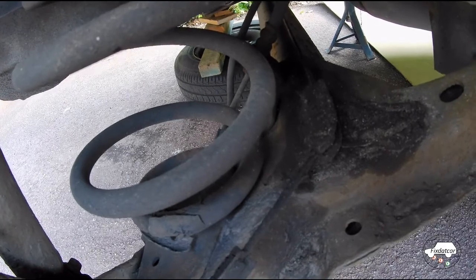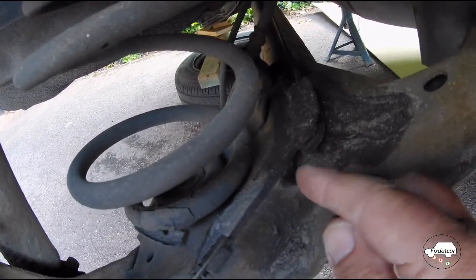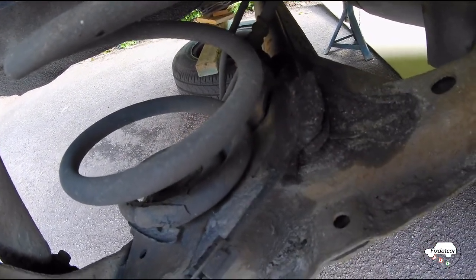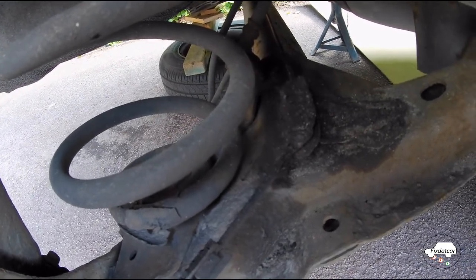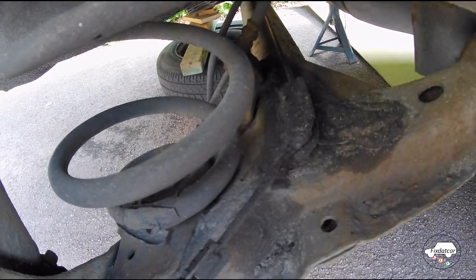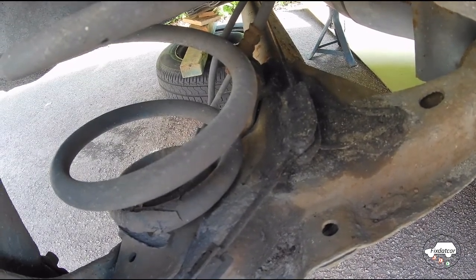I've greased it up to free it, but just about there, if you can just see it, there's a piece of the cable come loose where it's broken. This is typical. If a handbrake cable goes rusty, it'll become stiff to operate. You can grease it or oil it to free it, but there's a fair chance it will fail subsequently. So if that's happened, it's well worth replacing the handbrake cable on your car.